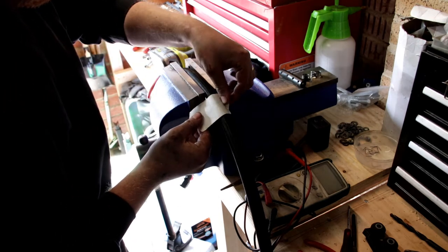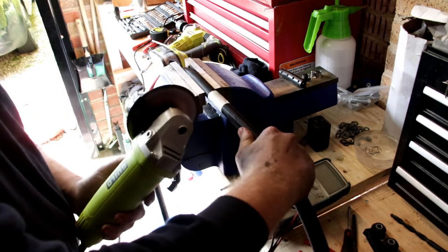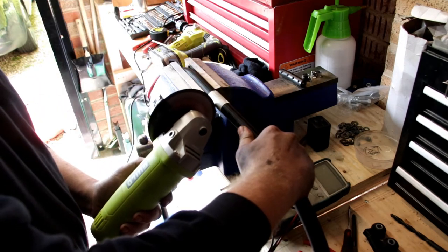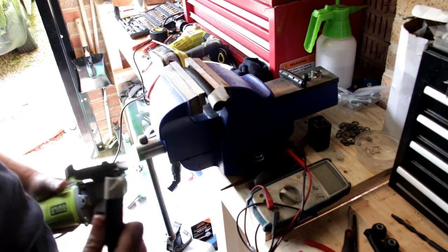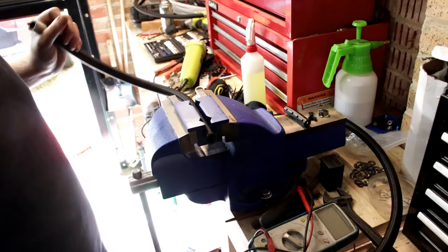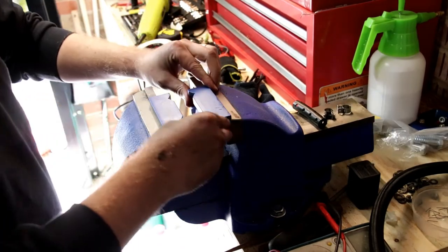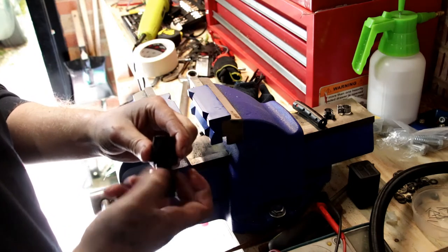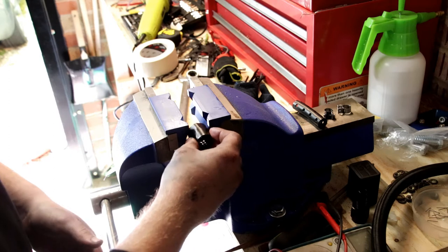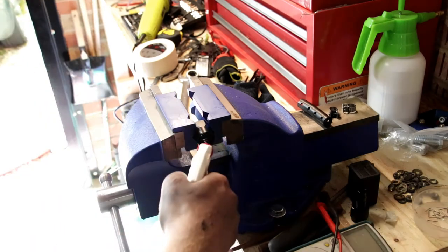After we've made our oil filter housing bracket, we can then move on to cutting our new oil filter feed hoses to length. Once we've cut these, don't forget to make sure you clean the inside of debris. Use plenty of lubricant when making up AN fittings.